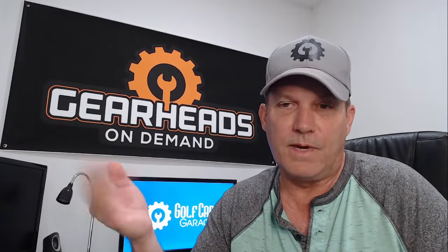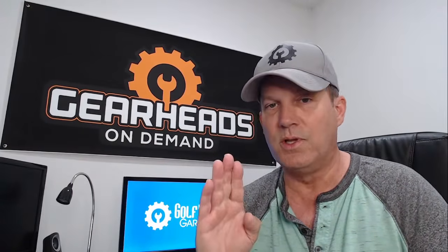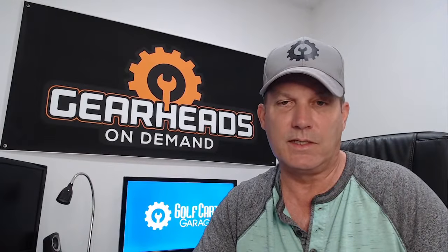So my advice would have been to get your MCOR tested, because on his particular car you could go to a Club Car dealer and they could plug in their computer and test his MCOR. It would show 0 to 100%: 0 with throttle up and 100% with throttle down. And it would show 150% or something if it was going over signal. So they could figure that out real quick by testing his MCOR.